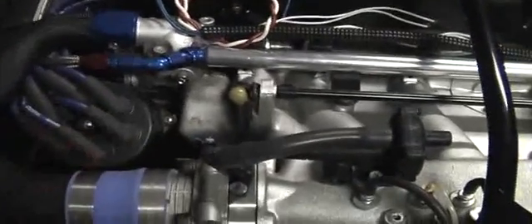Back to the engine bay — that's the Optima 34R battery. It fits in there perfectly; I had to make a little bracket against the firewall to hold it in place since I didn't have the stock bracket anymore. Here's some of the flying leads I still need to connect — these are all powers and ground returns for all the sensors up on this corner of the car. These are all flying leads from the MegaSquirt — all signals from the sensors — so I just got to tie those in, mount my coil over here, tie the wires to it. It's a fan controller, and my wideband oxygen sensor is wired back to the car. It's an LC1 — bought it with the MegaSquirt.